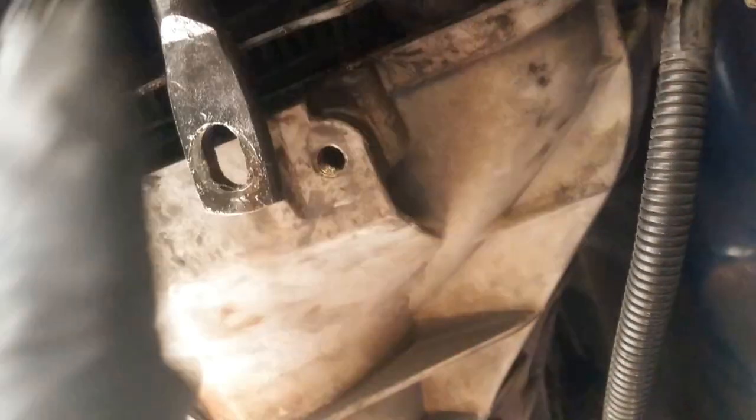All right, just kind of want to update you. It's actually the next day. Yesterday, my phone died, or was getting low on battery. So basically, the way I was getting in the transmission is I actually pulled down the motor. I grabbed it from the starter, right up here on the top where the solenoid's at, and I pulled down just a tad bit, and the motor came down a little bit. And then I was able to bring in the transmission a little bit.